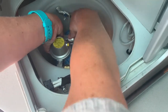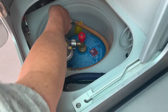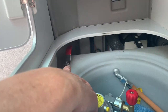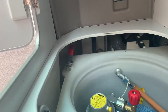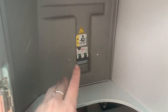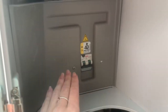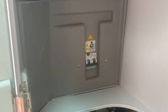There is a foam wedge on the side to stop the gas bottle rattling whilst you're driving. Next to the gas cupboard we have another red lever which allows us to empty the fresh water tanks in the winter — if you move this you'll find your fresh water draining away. Here in this cupboard we also have our electrical power point. Green means off, which means there is no electrical power. It is really important that you have this set to off before you plug it into an electrical hookup point.